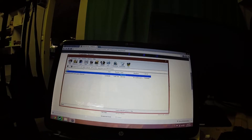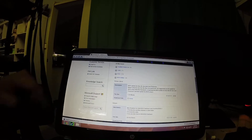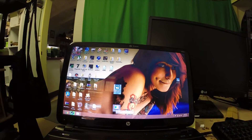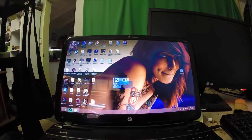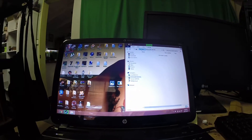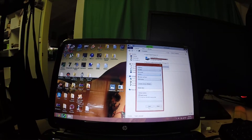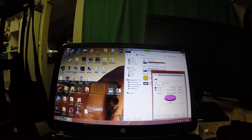So you're going to want to grab this file. Make sure that you extract the Saber Tooth Z87 file before putting it on the USB, because it has to be a CAP file. So you've got these two files now — the BIOS renamer out of the renamer tools and the Saber Tooth. Before you copy both of those, you're going to want to right-click and format the USB to FAT32 and then click Start. It takes a little bit.